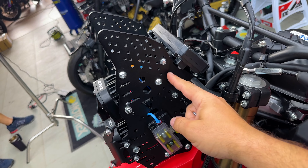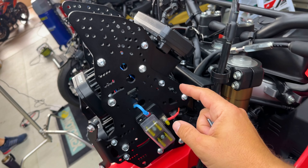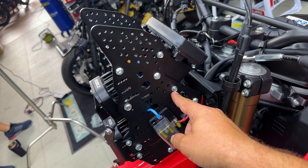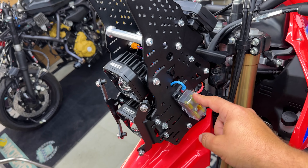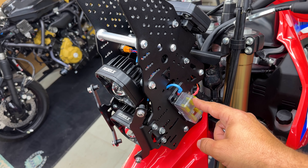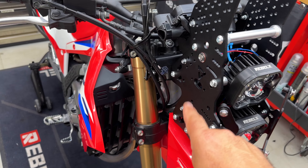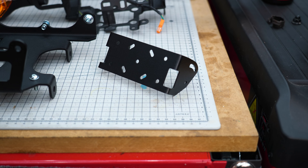Now that we've placed this side back on the tower, you can see it from this view. I missed this step but it already has the threaded insert, so you'll just need to place the bracket — once you have it with all the dashboard on — in here, and put the M6 by 16 bolts. On this build you see the fuse box on the left-hand side, but in reality the fuse box will always be on the right-hand side.